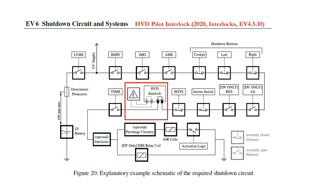The high voltage disconnect, or HVD, must be fitted with a low voltage pilot interlock. There is a general requirement that any tractive system HV connections should have a pilot interlock to prevent high voltage terminals being exposed when the plug and socket are apart. The LV pilot interlock is part of the shutdown circuit chain so that removal of the HVD will break the shutdown circuit as well as breaking the HV current path. The pilot interlock is just a shorting link within the removable HVD plug.